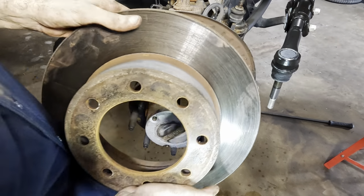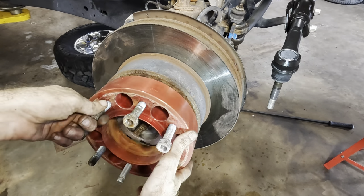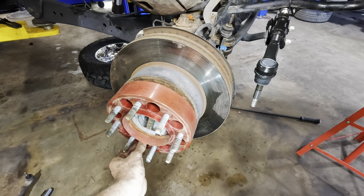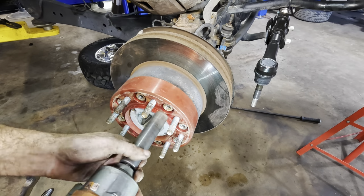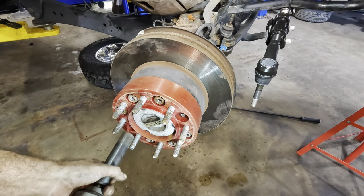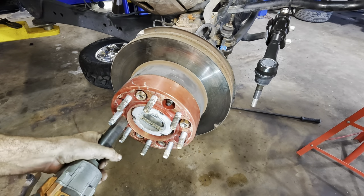All right, 60 pound brake rotor coming in. Slip that guy over the studs. Get you set up. And then comes our wheel spacer. We gotta have the spacer. So let's go ahead and bolt this thing down. That'll help keep the rotor straight. It'll make it easier to get the caliper in position. Let's get it tight. It's not centered. Bottom it out. There we go. Bottom this one out. That's good. Should be centering up now. Should.